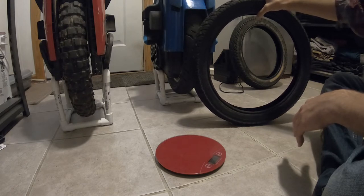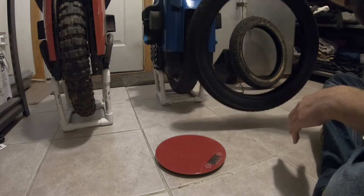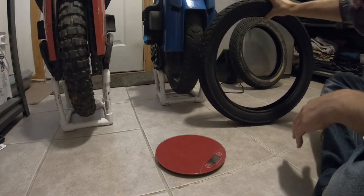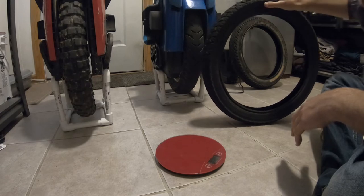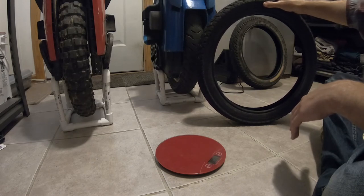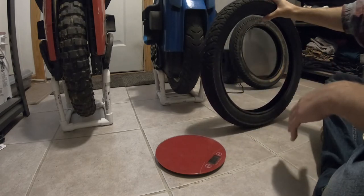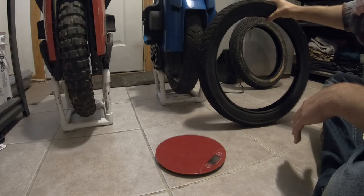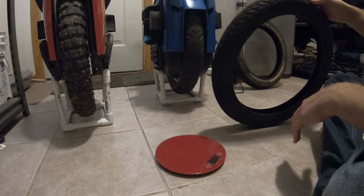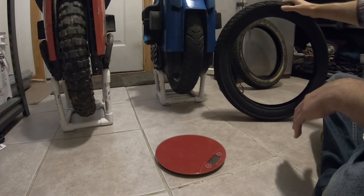The only benefit to this tire is that it's so light that your acceleration and deceleration will actually be noticeably better — your wheel will be a little more responsive off the line because there's basically no inertia to it. But there's also no gyroscopic feeling, which contributes to wanting to fall over. Really all that can be said about this tire is: ride it like you stole it, try to kill it as fast as possible, and look forward to putting on a better tire eventually.